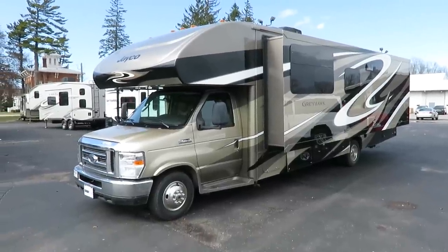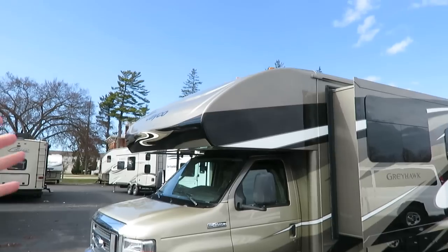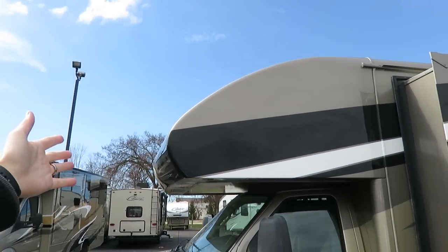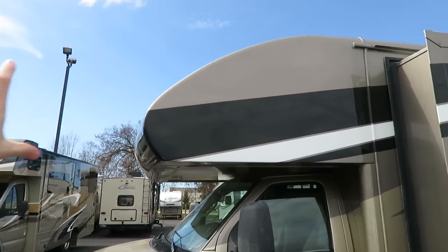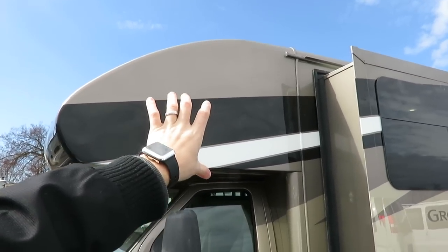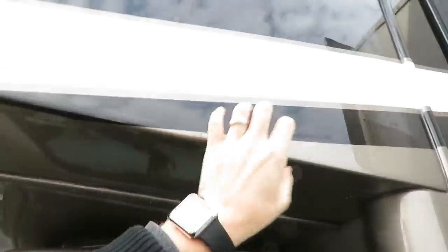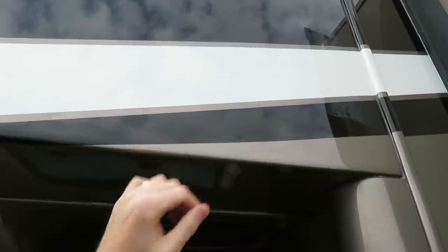You also see the one-piece sleeve over nose cap. Someone once said, 'if this cap ever falls off, the whole top of my RV is exposed.' But the whole wall does extend up into this — they sleeve this cap over top for an extra layer of protection, then move the seam down. When seams are on the corners, that's a high stress point — it's not if but when you'll have a leak. When I take in a used Class C, I ask where the leak was in the overhead cab, but that's not a problem here.